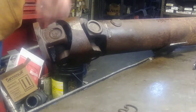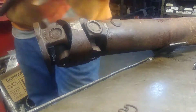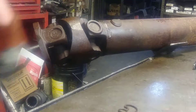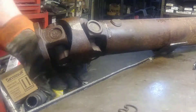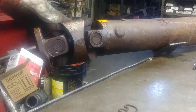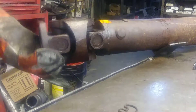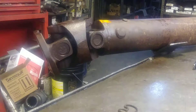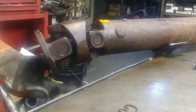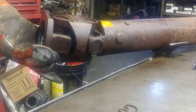Now, all my snap rings are off. What I do next, I like to have the drive shaft up off the ground and on the table, concrete blocks, whatever. Have the CV head hanging off your platform. Your drive shaft end is called the flange yoke. Take the bottom of the flange, lift it up, just hold it up even with it.